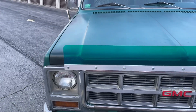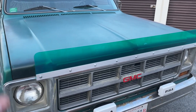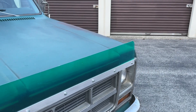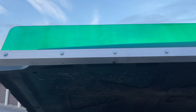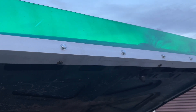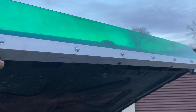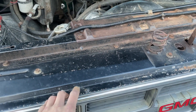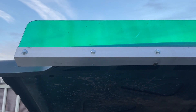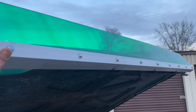Got the bug deflector all in place. I've had it on here for probably two, maybe three weeks now, so it has gotten a little chipped up. You can see there are some bugs and dust on it, but overall I'm very happy with the way it came out. Figured I should show how it's actually mounted — it's pretty simple. Just three holes on the underside with countersunk allen head bolts so it sits flush, because normal bolts were hitting the top of the core support and the hood wouldn't shut. It's a little snug because of how thick the aluminum is, but I wanted it to be sturdy and solid — that is not going anywhere.